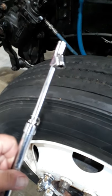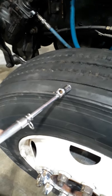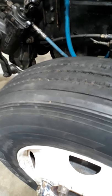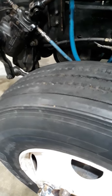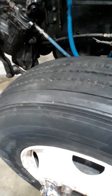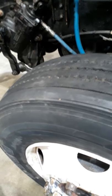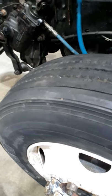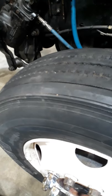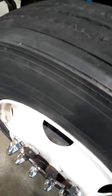Standard tire pressure gauge — when you're checking tire pressure, you should use the OEM specification for the vehicle. There should be a placard inside the vehicle that tells you what your PSI should be. It is listed on the tire, but that's a generic tire manufacturer specification, so you're better off referring to the vehicle specification for inflation because it'll be different for a single tire versus a dual setup. Always refer to that.